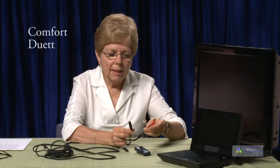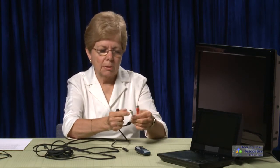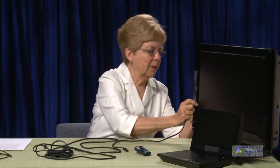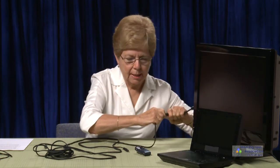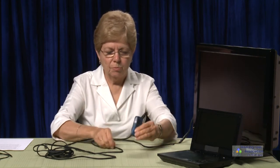Now I'm going to show you how to connect the Comfort Duet to the TV and to a DVD player. To connect to the TV, I'm using a 3.5 female adapter connected to a Y2 RCA cable with male connectors, connecting them to the TV with a rolling motion so they go on easily. Using the end of a long cable with a 3.5 male stereo adapter, I connect the two together. On the other end is a 2.5 millimeter stereo adapter, and the secondary mic attachment on the Duet is also 2.5, so I simply join the two together.